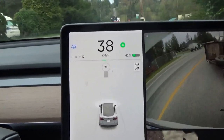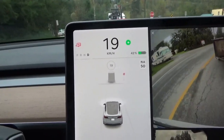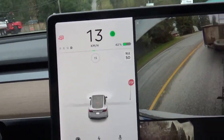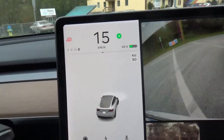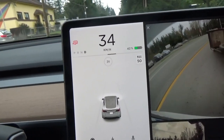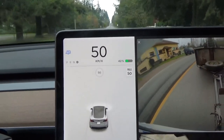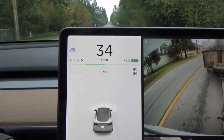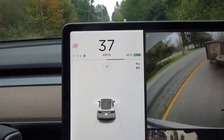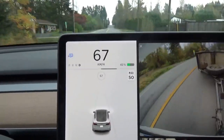And that is because my left trailer light assembly is a bit bodged, a bit messed up. It sort of works sometimes. So there it turned red because I was on the brakes or the rear braking. Going straight, it's going to turn to blue again right there. But if I put on my brakes, red. All right, so I think I need to replace that back left trailer assembly.